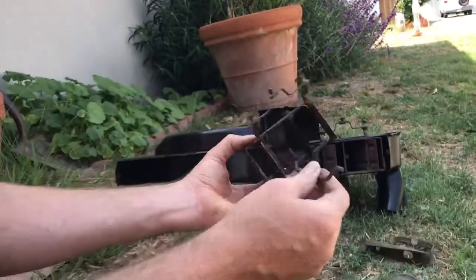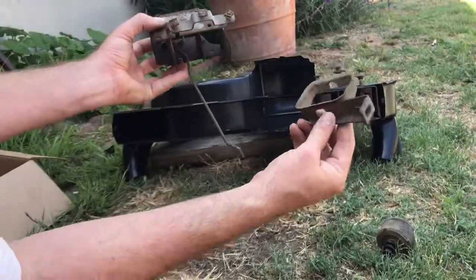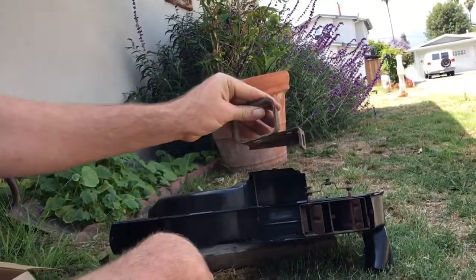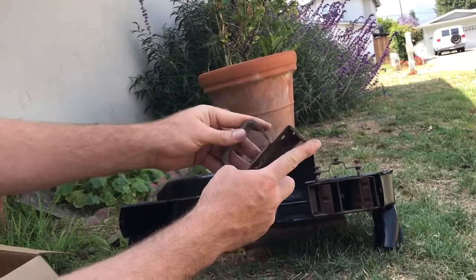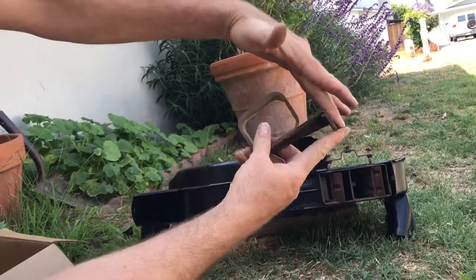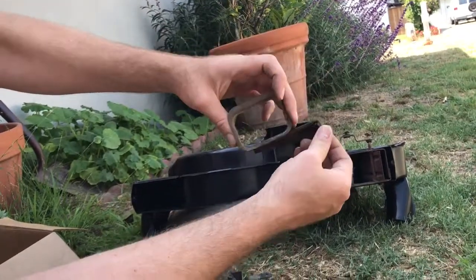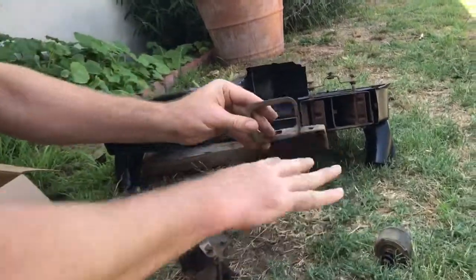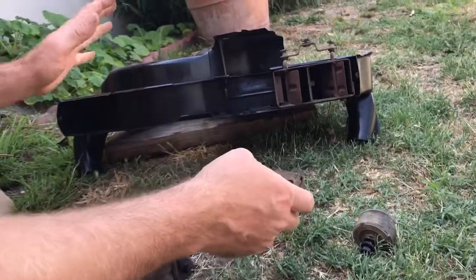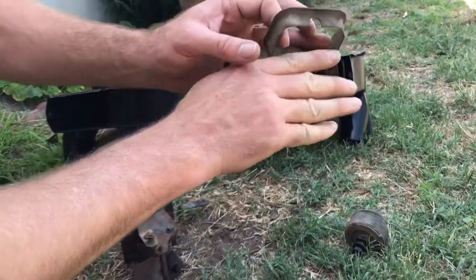Just to note, this bar is also different in the earlier versus the later models, and so is this bracket. This bracket is for a Type 1 engine — you'll notice it's flat right here. The Type 3 engine, my understanding is, actually has a little lip that extends this way so that when you slide it in place, this little lip fits onto the side of the engine. There are two engine tins, and this actually divides the two engine tins on the right side as you're looking from the back towards the front.